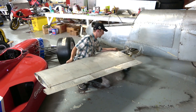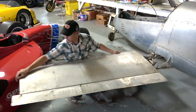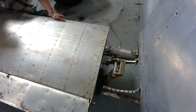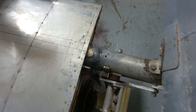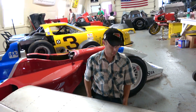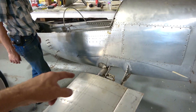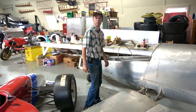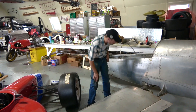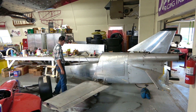Now, these are the A wings — is that right? A or B? I think they're A because they're short. They're really short. So this has a circular cross-section spar in it — a tube spar. Correct. And it slides right over this big box and goes clear up to here. You're going to have to drill a hole in this tab, and the wing will literally be held on by one bolt. Pretty much, yeah, because all the forces are basically up and down and nothing's pulling it in or out. So one bolt is more than enough — it's efficient. Excellent. You've got your flaps and ailerons. The big fiberglass fillets you'll have to be working on. I believe it's just that one aluminum rib, and it rivets to the fuselage.